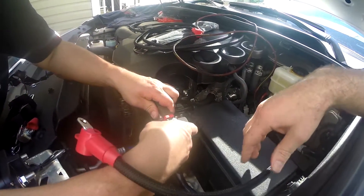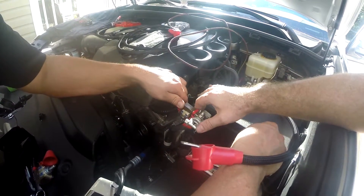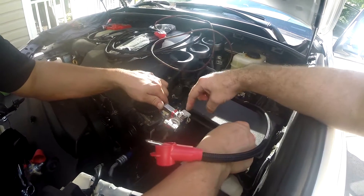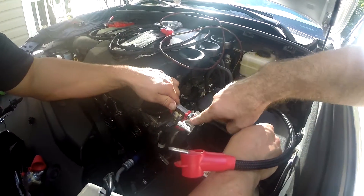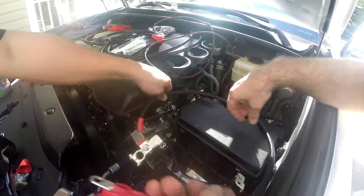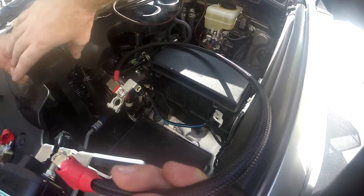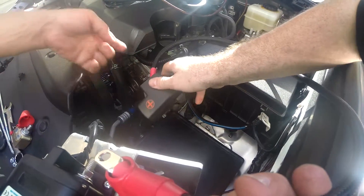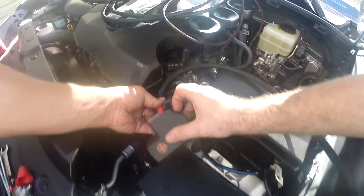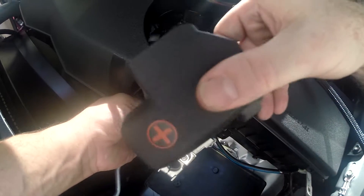We are wiring the main battery fuse and cable that goes to the switch. This kit uses the stock battery terminals, and it took us a second to figure out exactly how we were going to do this. We've angled the busman fuse — we've bolted it on top of the two main factory connectors and have it angled down with the cable hooked on the bottom. It's facing out and looping around, and we're going to zip tie that along inside the chamber. We can still put the cover on and there's a place for wires to exit out of the side, so it'll fit right on top of that busman fuse like it's supposed to be there.